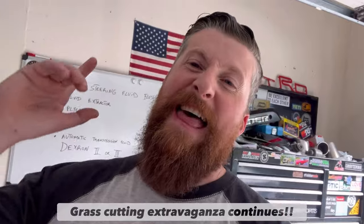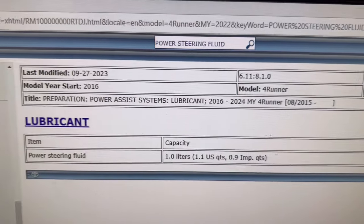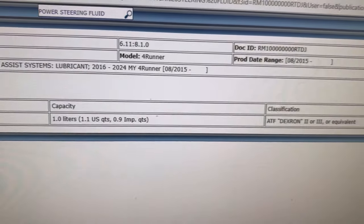As you guys can see, transmission fluid is the correct fluid to do this particular flush. There will be a lot of controversy on this one, because you're going to have guys that tell you, oh, but my car came with yellowish — more of a clear yellow-toned fluid in it. Yeah, it did. Toyota did that on purpose. Toyota also threw everybody a curveball because they wanted the car to present a certain way, so what they do is use dyes. Think about Royal Purple — what color is oil? What color is Royal Purple? It's kind of the same concept. They just didn't want to sell you the car with red fluid in that container, so it looks a little more presentable, I suppose.